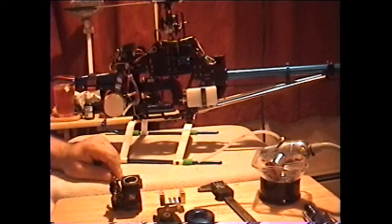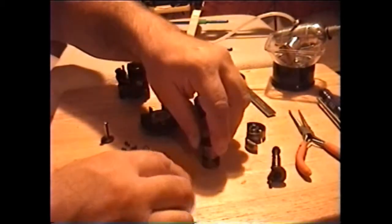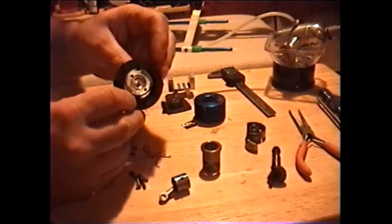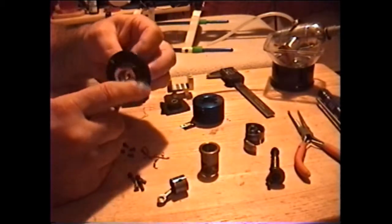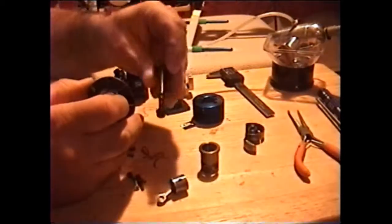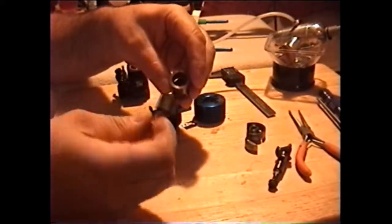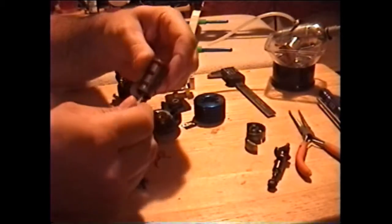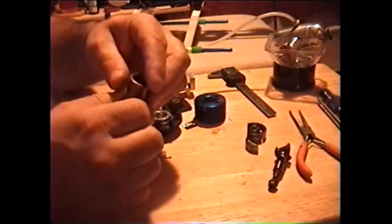But finally, I said I'm going to take it all apart again and take the flywheel and the fan off this time, and check whether a bearing is locking up, causing it to slow the motor down and seize. But I goofed up. I put a screwdriver in the exhaust port, not to remove the piston, but to remove the fan. It's not a pop-off like the other one I have. It's actually threaded on, so you have to unthread it off the crank. When I did, the screwdriver going into the exhaust port left a nick, and I messed up the piston. There's also a lot of play. Right now it seems tight, but it's not. It's the nick in the exhaust port that screwed it up.